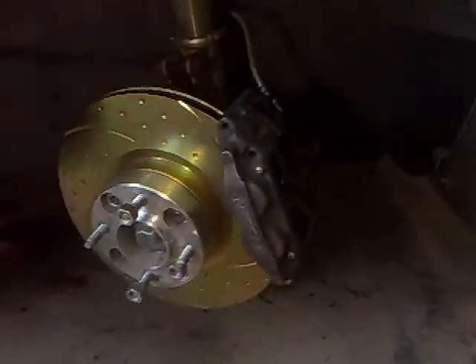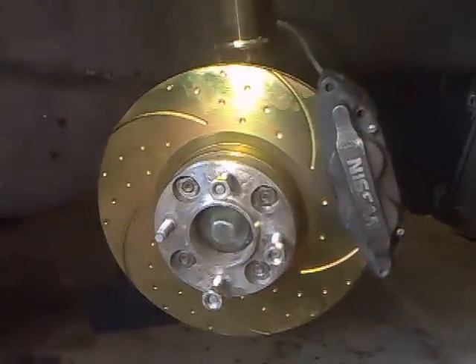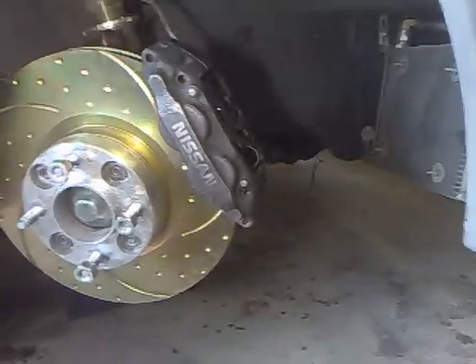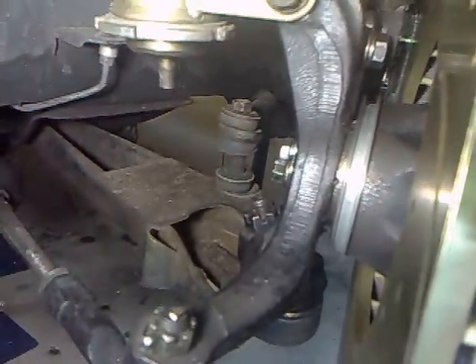Basically I'll go down to the brakes. You're looking at a 350Z non-Brembo 05 front rotor with a Z32 TT four-spot caliper. On the back, I actually got the brake caliper to mount using an adapter off US eBay which was meant for the Silvia for a big brake upgrade. Seems to work well. If you look at the back there, I'm running a Silvia hub which makes things easy — there's a lot of aftermarket parts once you go over to that setup.